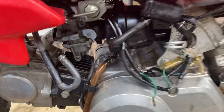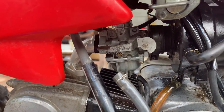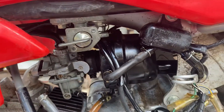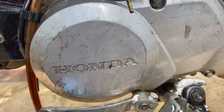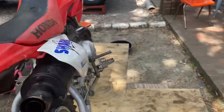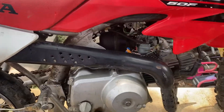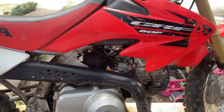He said it don't want to stay running. So we're going to take that carburetor off and clean it out. Drop these old fluids because the gas smells bad, you know. Let's clean it out for them a little bit, give them a fresh start.